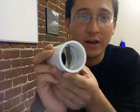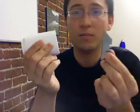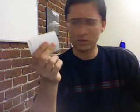First thing, let's note there are a couple of notches in here. I don't know if you can see that. A slightly longer one and a shorter one. That'll come into play in a minute. But once you've removed that end cap there, then you have easy access to the blade here. It should slide right out, so if you just carefully reach in there and pull it, there we go, pull it right out. That's a dull blade now. Into the trash with that, carefully of course.